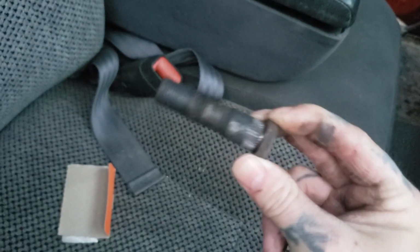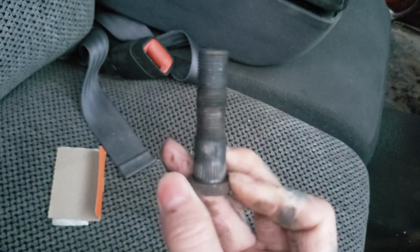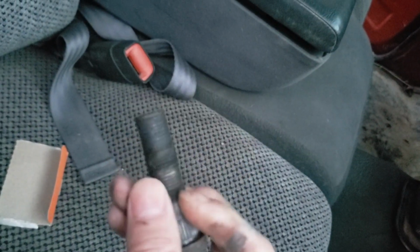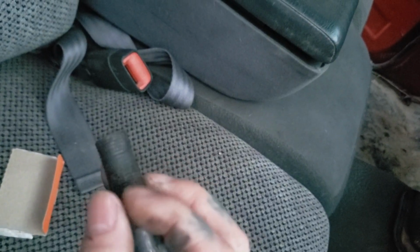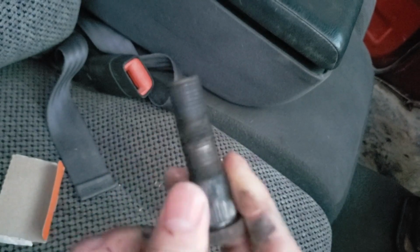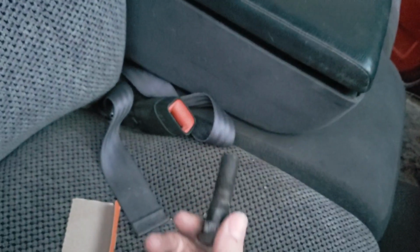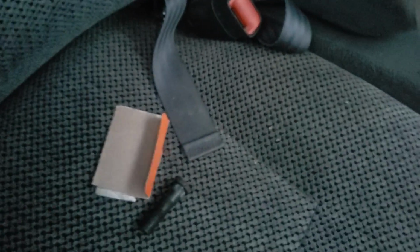This is my old lug stud, and as you can see, if you look real close, it had a little wear down to it, uneven, and that's something you need to look for because that can over time weaken the stud. Now this stud is probably still usable and good, but I wanted to change them anyway, and when I changed them, the part store gave me the studs that you see on the truck now, and it wasn't the right ones, so I got into a predicament.